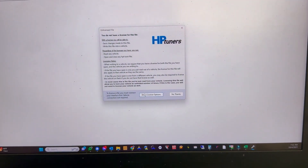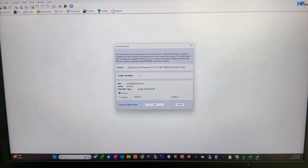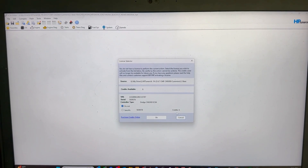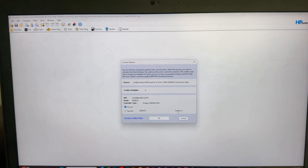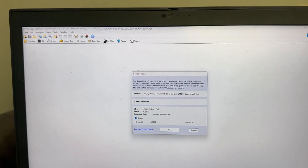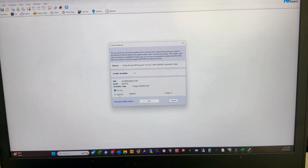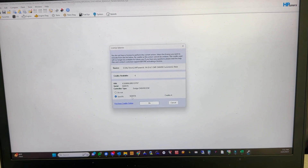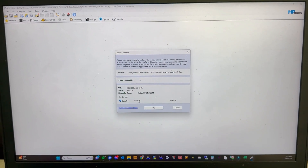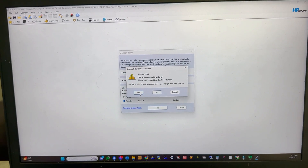Show License Options. Now before we go any further, you guys should be in your truck with internet, plugged into the MPVI with your computer, MPVI plugged into the truck. Earlier when you re-synced the interface and it added six credits — this is where you need them right here. So if you get to this spot and you don't have six credits and you're supposed to, go back up to the Help tab, make sure you're connected to the internet, and hit Resync Interface. We're going to hit Specific right here. This should match the serial number on the sticker on your ECM. So we're going to hit OK. This cannot be undone — are you sure? Yes, I'm sure.